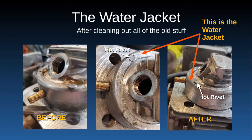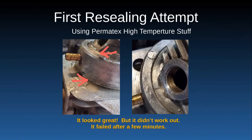The resin they used evidently failed, so the water jacket itself works fine — it's just that you can't seal the water in it, and that's what I hoped to solve. What I did initially was use Permatex high temperature stuff. It worked great and looked great, and I thought I had a great result, but when I got to using the engine after a few minutes it failed. When you're sanding and chipping with wire brushes and all that, cover up the spark plug hole so you don't get crap going down inside of it.